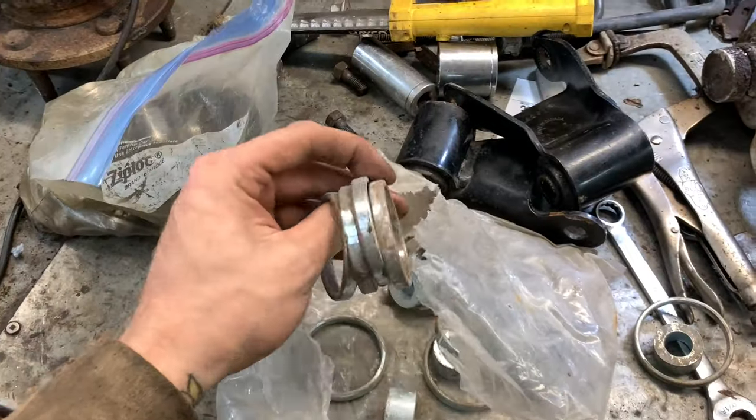This may work very, very well in my application because where I'm bringing the axle up closer to the level of the transmission, my drive shaft may be a little bit too straight or linear. You gotta have a little bit of drive shaft angle, or driveline angle, on there so that the U-joints can rotate and not get kind of seized up. So when I get my drive shaft in, I'll check my drive shaft angles. If it's under, say, 2 degrees, I'll probably put this spacer in behind the transmission and then offset my rear diff the same, just to see if I can get it up closer to, say, 5 or 6 degrees.